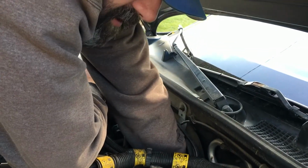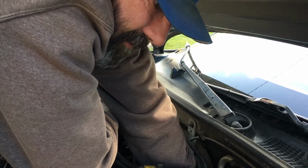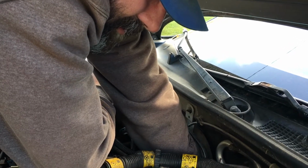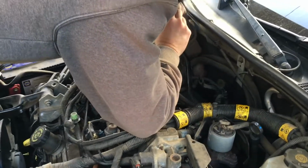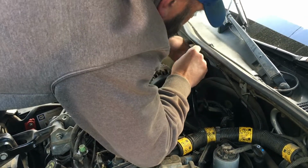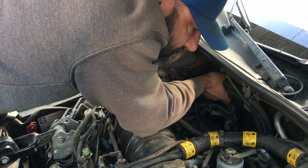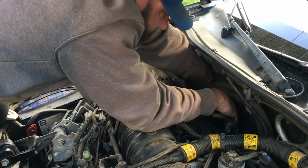The other thing to remember is that they spin the other way, right? Because they're facing you now, they're not away from you. So just remember that. It's righty-tighty, lefty-loosey to the plug, not necessarily to you. So that one's in. And the last plug, this one's a little tight if you got larger arms, just because the heater core cables, tubes, pipes, hoses are right here. So they make access not quite as easy. In fact, I'm going to try it with the other arm here.